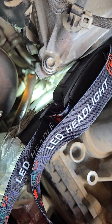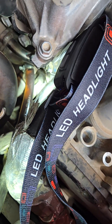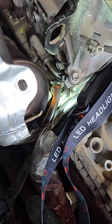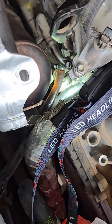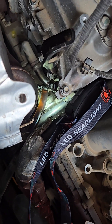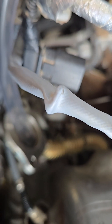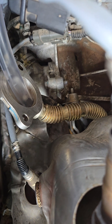I hope this helps people thoroughly clean their EGR cooler. Again, do not just use purple power, clean it, and stick it back in — it's going to take less than a year before it gets clogged up again with carbon. It's like a magnet if you don't neutralize it. Do not overfill it either. I'd suggest doing this once every two to three years depending on how much you drive, or use a borescope and endoscope to look inside and check how clean it is.